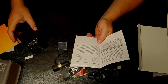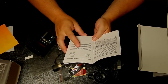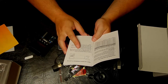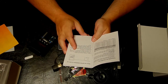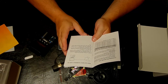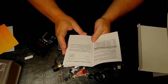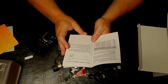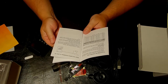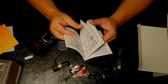They want you to do a quick test before you install it. Insert a memory card, and using the USB cable, connect the camera to a USB power bank or a 5-volt USB phone wall charger for a quick test before installing it in your car — do not plug it into a computer. The camera should start video recording in a few seconds and will show output from both cameras. If necessary, format the SD card before you start.